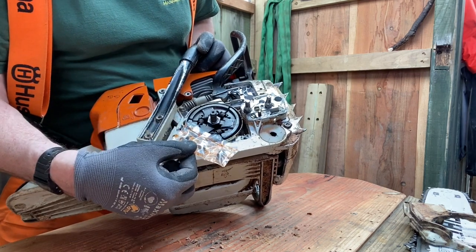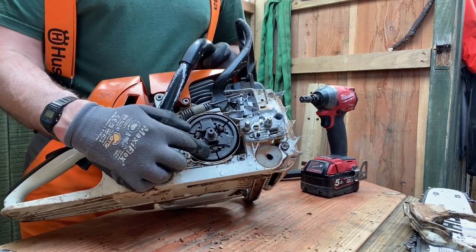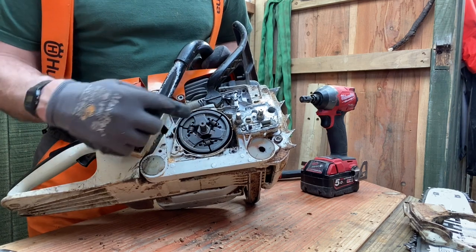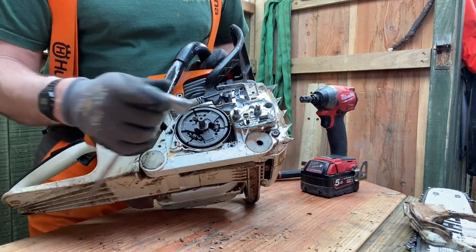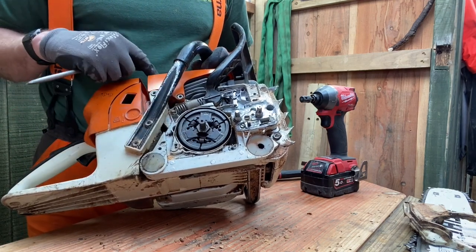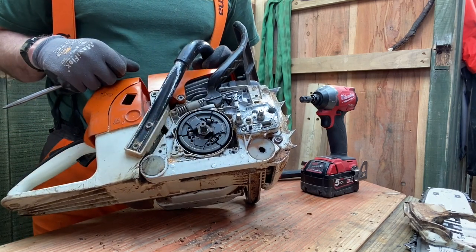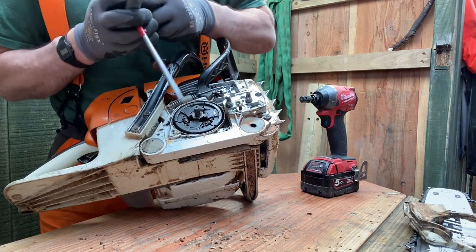I want to replace these three springs with three new springs to hopefully fix the problem. The clutch on these chainsaws is screwed onto the crankshaft with a left-hand thread, and it's extremely important to remember that when undoing this, you undo it in a clockwise direction. There is a nut in the middle to help you, but the problem is if you just turn it, it turns the engine and doesn't undo itself. So somehow you either need to jam the engine - which people used to do by putting rope into the piston - or use another method.